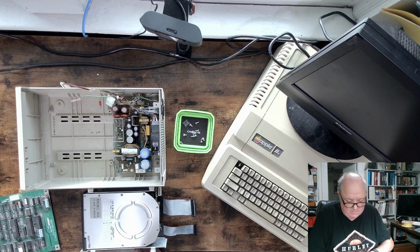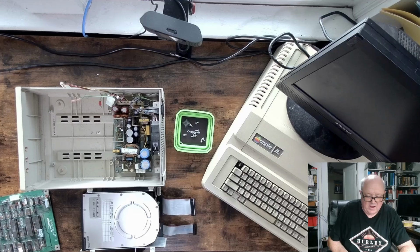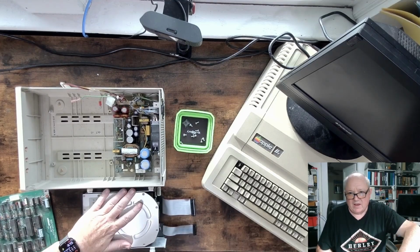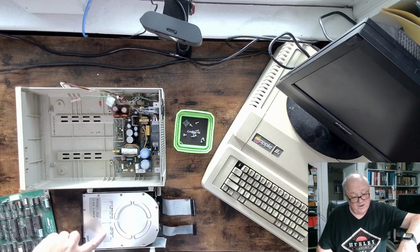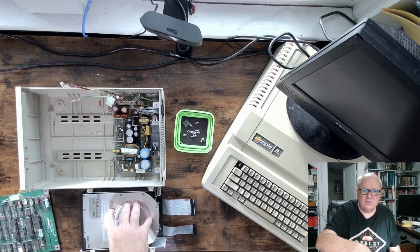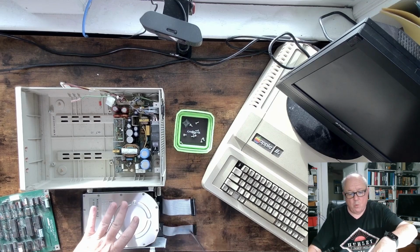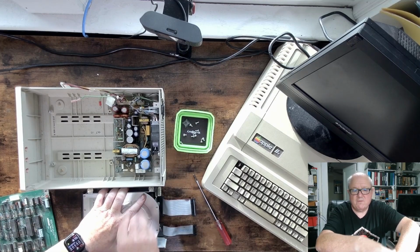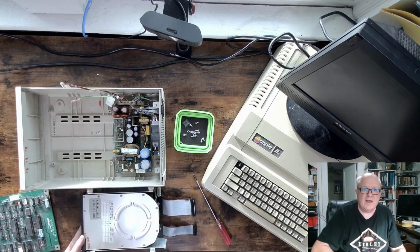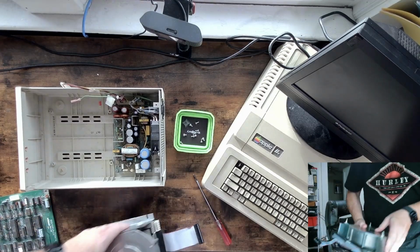Something I should mention, since I'm doing all this, and in fact I'm moving this hard drive around, and I haven't done what I'm about to tell you. There's one of the utilities that you run on the Apple that allows you to update firmware on the drive, exercise the drive, check for bad blocks. On these old drives, in fact, you'll see a list of media defects. They could have bad blocks, and there are spare cylinders and tracks specifically to offset those, and the system automatically maps them. And if you have a bad block checker, it does that mapping for you. One of the other things you're supposed to do with that utility is park the heads for moving the machine around, especially if you're shipping. Because if when it gets turned off, the heads are in the middle of the drive, if it gets rattled, the heads will sit there and bounce on top of the platters, and you kill the drive. If you park the drive, they get moved off to a secure area that won't damage the drive if they bounce around.